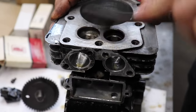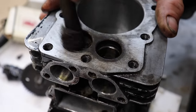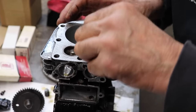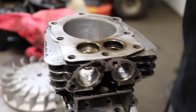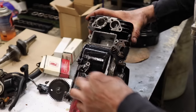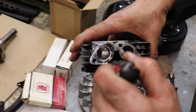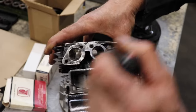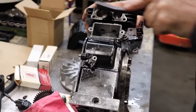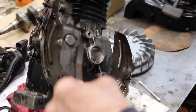So you can use this little wire brush, and let's kind of clean this up a little bit. Let's get that off of there. And then again, you could loosen it up, get in there with a Q-tip if you have to, put it back in your 5-gallon bucket of kerosene, rinse it off some more. It's a lot of back and forth to make sure you get everything, because a lot of times you miss stuff. You may be cleaning part of it and look in here and go, oh, there's a bunch of crud in here I missed. Let me get in there with a screwdriver and chip that away, depending on how bad the block is. Let me loosen some of that up. Maybe I can get in there with that little brush. Oh, here's some gasket I forgot to get. Maybe I can brush some of that off here. Use your head. That's all you gotta do.